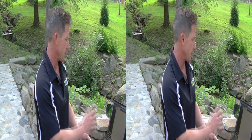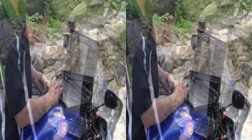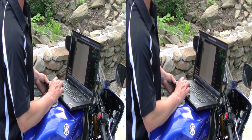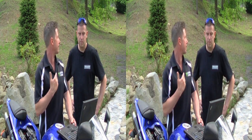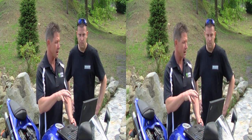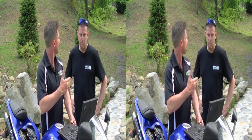Go back to Power Commander Tools. One of the things we've been doing is running an auto-tune, so we had a target air-fuel feature set in here, along with the base map and the trim map. We're pretty happy with the trim map, but we're going to go in and zero it out so it'll start correcting over the base map from where it is now, with both the lower injectors and the upper injectors evenly — that usually works the best. Now you're going to take it out and ride it around, and when you come in we'll save the auto corrections it makes. Each time we do a save and update it, it'll run better and better.